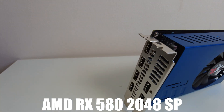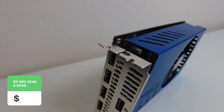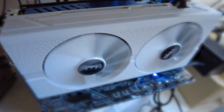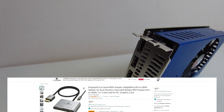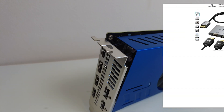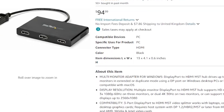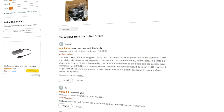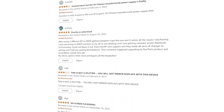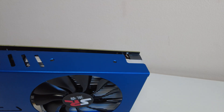Of course, there are six HDMI 1.4 ports. This card cost $125, which is pretty expensive for an RX 580 2048 SP. But think about it — the alternatives are using two graphics cards, or a DisplayPort to HDMI splitter, one of those multi-monitor ones. A three-way adapter runs $95, or $40 for a two-way adapter, so you'll probably spend the same amount anyway — and it may not work that well. Plus, you're limited to 1080p at 60Hz with a three-way adapter and it can get messy with all the wiring. So actually, I don't think $125 is that bad of a price.